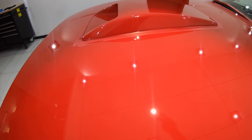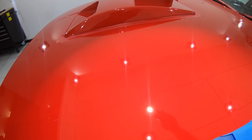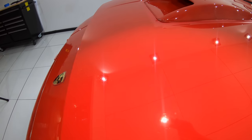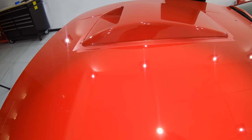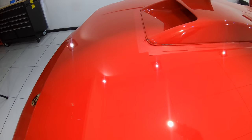Having a look at the results in this second test section, I can clearly see a much better leveling ability with a good 75 to 80% defect removal. So it's really been able to once again remove all the lighter swirls, but also all the moderate ones, though the slightly deeper defects are still remaining. But in relation to gloss and saturation levels, it's also definitely a step down with some increased haze and micro marring in the finish compared to the first combination.